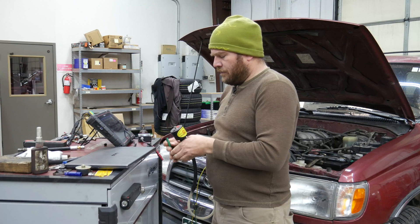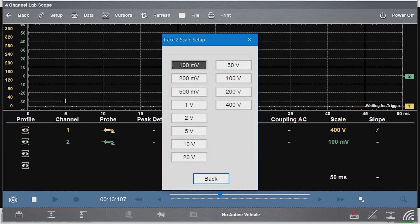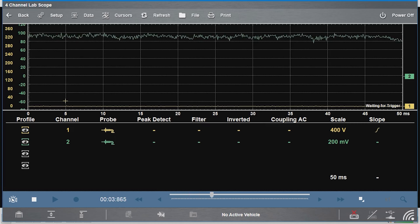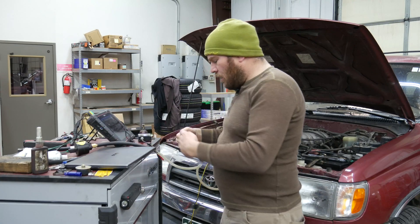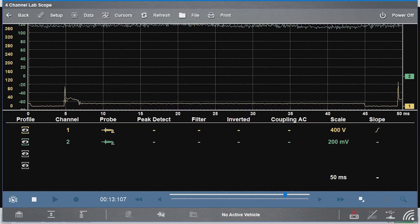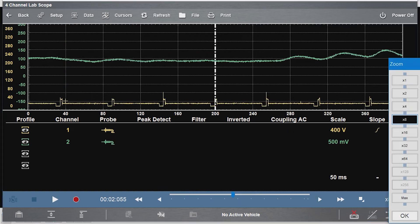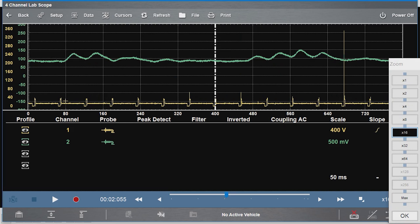I'm already hooked up on the radiator. Hook my two wires on here. We're going to start with 200 millivolts. I'm going to hook my sync channel up to the coil. Let's fire it up, see what we get, monitor our hose, make sure we're not getting coolant in it, and hopefully we get a good waveform. Okay, our pulses don't seem quite consistent enough for me to identify a specific cylinder — they kind of come at random. So our next step is going to be trying a cranking test instead of a running test.